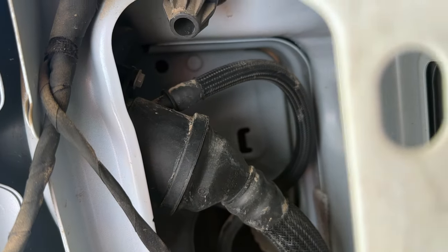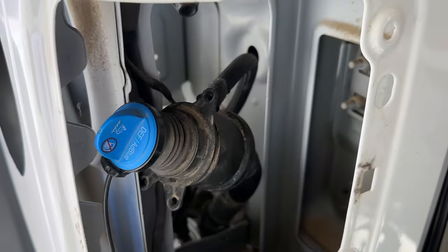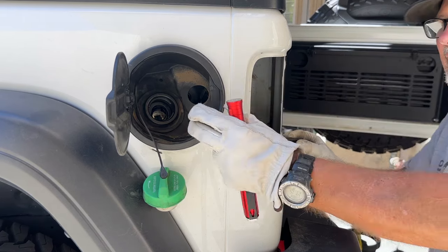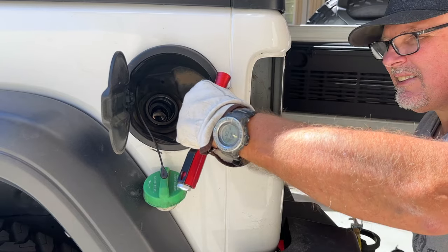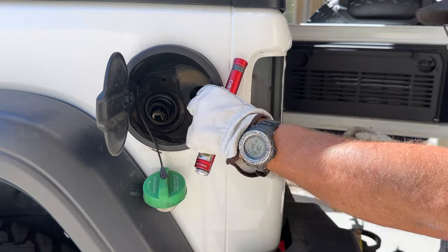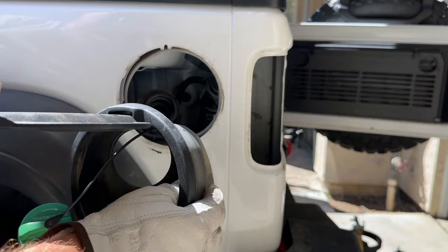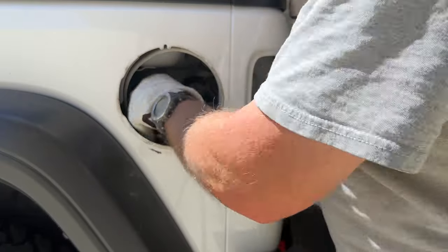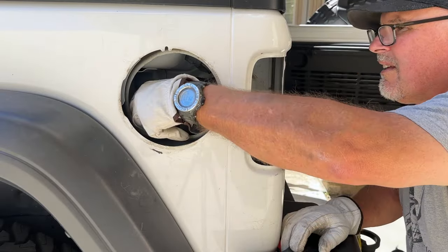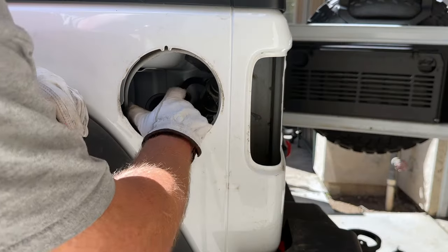The screws on the DEF line are very difficult to get at, but not impossible. Once you remove those, you can swing the DEF line out of the way and then it's detached from the fuel door housing. I was able to reach in with a long screwdriver and depress two of the tabs on the fuel door housing while simultaneously pulling it out. Getting those two tabs loose allowed me to remove the fuel door completely. The only thing holding the fuel filler line to the fuel filler door is a rubber gasket, so that removes very easily. There are two tabs that hold the discriminator into the fuel filler tube — I attempted to release those tabs and slide the discriminator out, but I realized that was not going to happen while the fuel filler tube was mounted inside the Jeep.